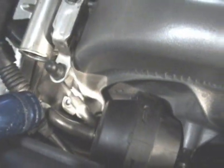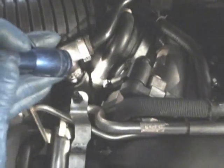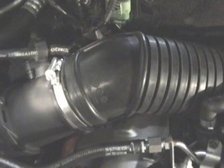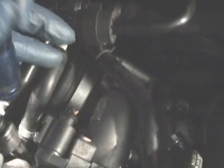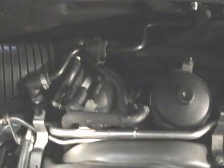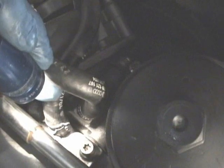On this side there's a vacuum line you need to unhook. Near the back of the motor, you need to unhook the vacuum line for the brake booster. You need to take your MAF boot off — that's one hose clamp, two hose clamps, and a fitting. Near your oil filter there are a couple connections to undo: there's one vacuum line down here with a reuse-type clamp that you can swing out of the way.